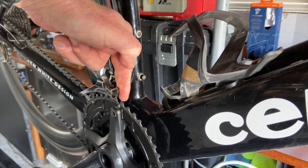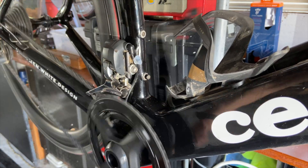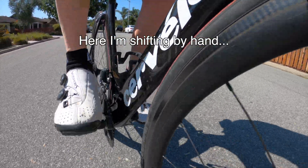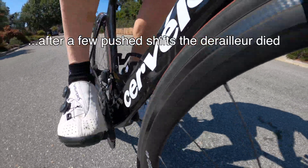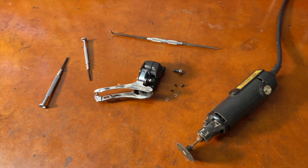That should help it out. I can do this when I'm riding, but it's not ideal. I reached out to Shimano and they let me know that the derailleur had to be replaced. I have a whole other video about that project, which I'll link to below in the description. In this video, what I want to do is take the derailleur apart because I was curious what's inside one of these little electrical wonders. Specifically, I want to see if I can find the part that Shimano said wore out — they called it a nylon worm gear — which I can kind of envision in my head, but I can't see it looking at the outside of the derailleur. So I'll do whatever it takes to take it apart, look inside, and maybe reason out how the derailleur failed.